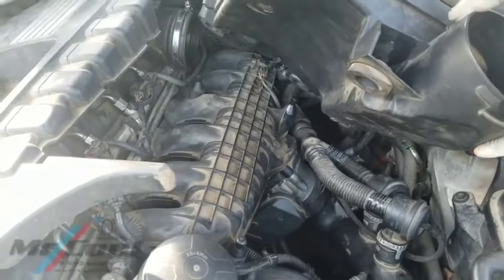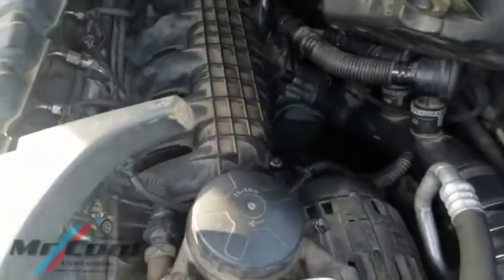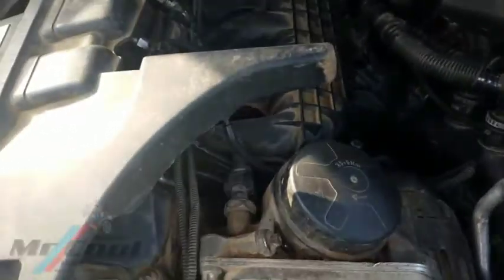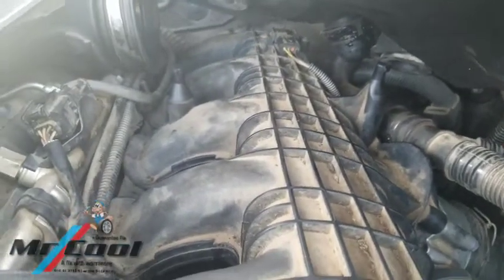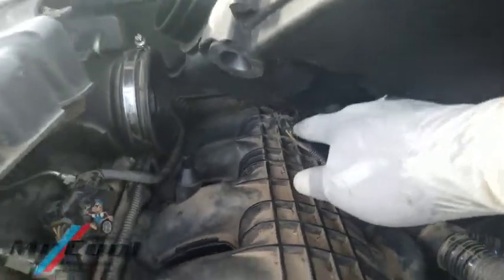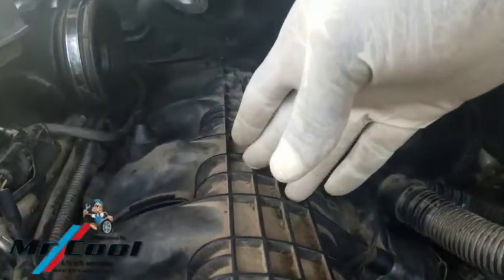If I take off this box right now — boom, that is it right there. Can you see that? There is no way there are going to be two mass airflow sensors or two MAP sensors in the system. What they did here, which is very interesting and which some other car makes are not doing, is place the mass airflow sensor right here on top of the manifold. Can you see that? I'm going to prove that to you.